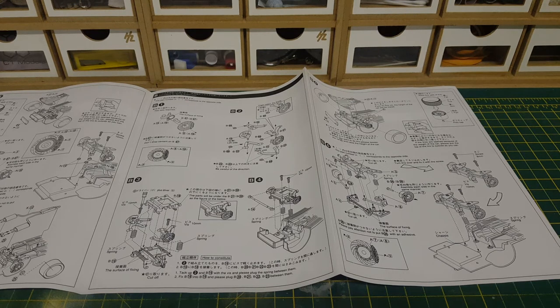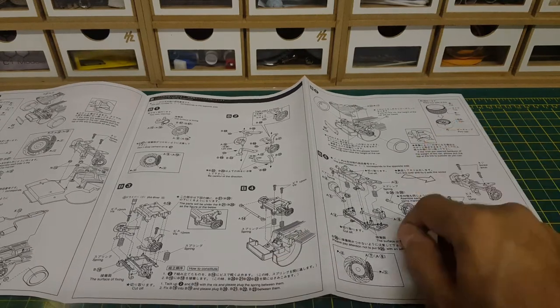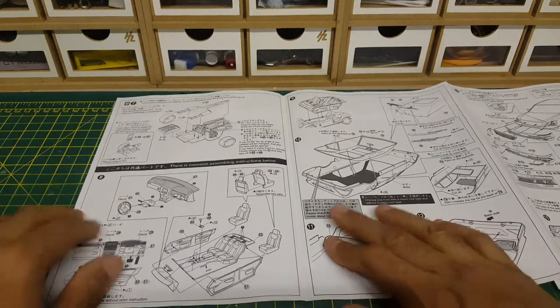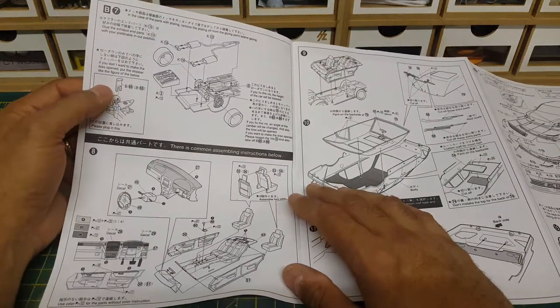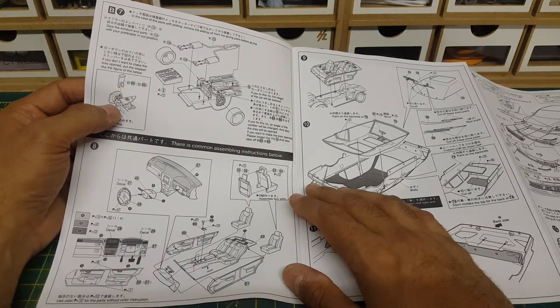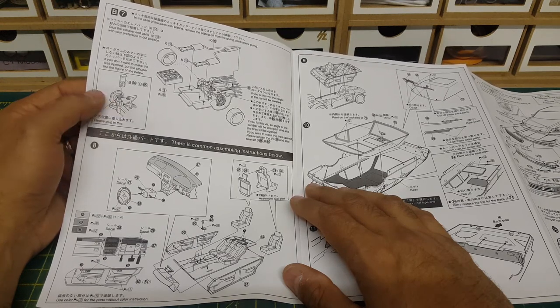With setup B you could get a creative three-wheeled look if set up a particular way. It looks great slammed with the screw method, though you have less camber — screwing the wheels up brings the camber in, almost like setup A but with adjustability. I personally have it with just a slight adjustment, sitting nicely tucked up against the inside of the arches. The little black pieces for the rear suspension can be plugged in to lock them from going any lower, giving a rear-high, front-low look, and also limiting rear camber.